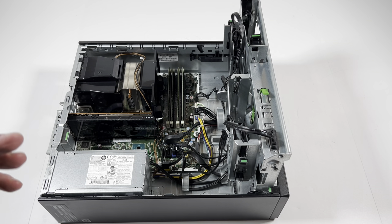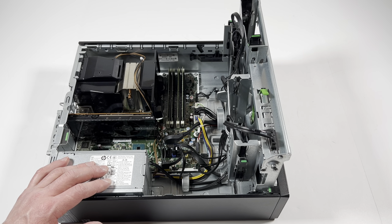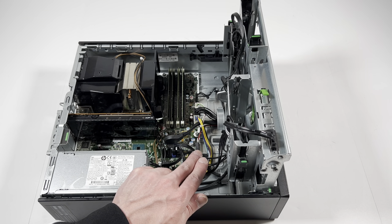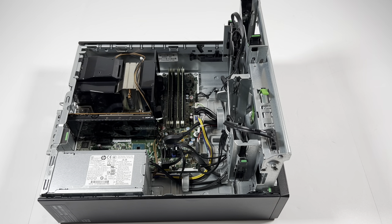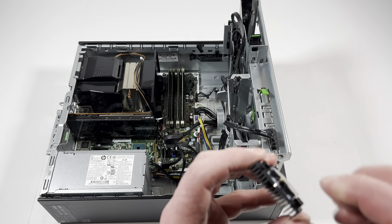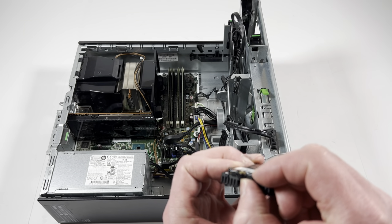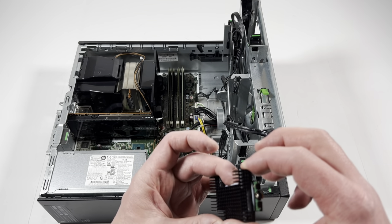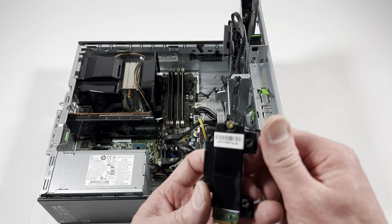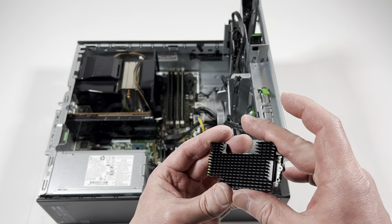If you're asking about the power supply, it's a 240-watt and it works perfectly fine with the RX 6400 — you don't have to upgrade the power supply. It will also support an NVMe SSD in the 2280 form factor. However, the problem is it uses a special standoff screw — about 1.5mm thickness — and they don't actually sell this screw separately; you have to order the heatsink through HP. I was looking online and they were about $30 just for the heatsink, which is too much. So I'd recommend just getting a two-and-a-half-inch Samsung SSD instead.